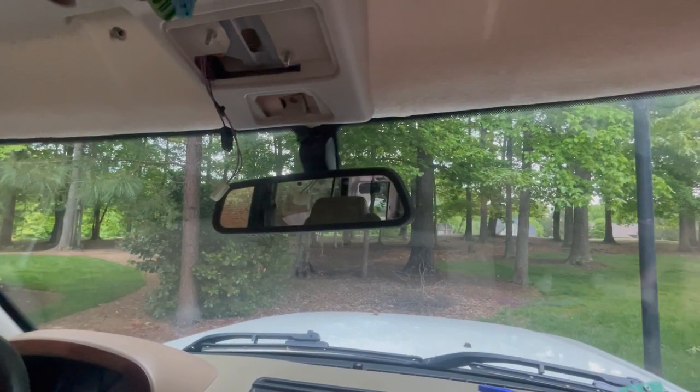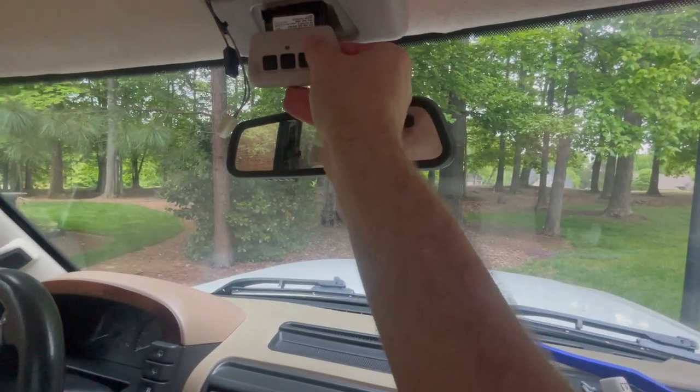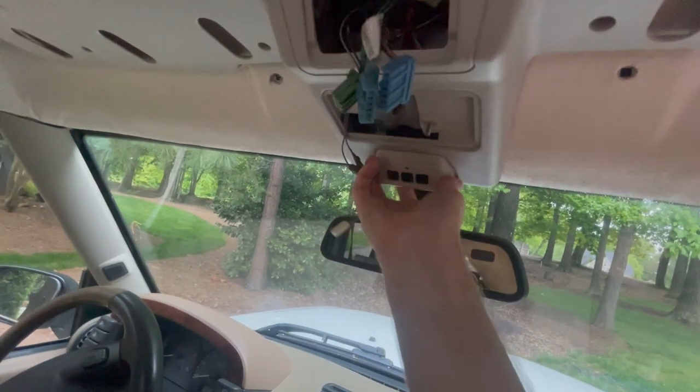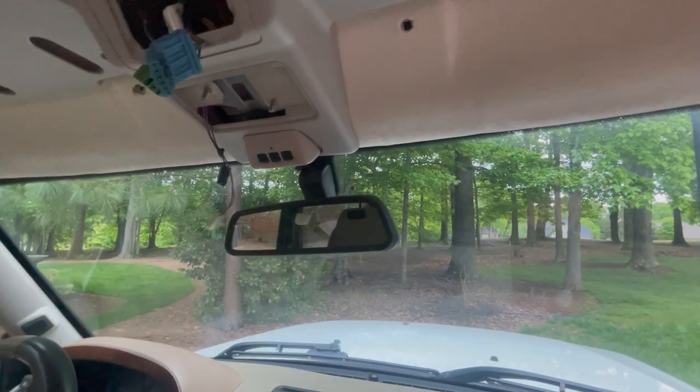Here, and then look, this is the garage door opener. This was at the one at the junkyard, but mine didn't have it, but it didn't work, so I've rigged mine. So I just rigged it. Let's see. It's working. But what I did was I took out all the internals and then got one of just my standard remotes and hooked it up so these buttons work my standard remote.